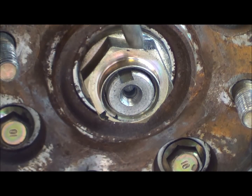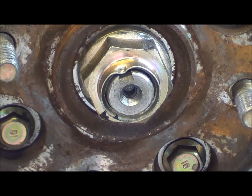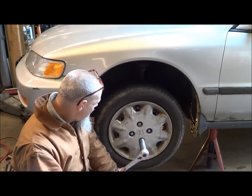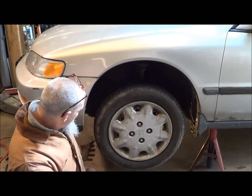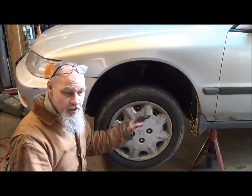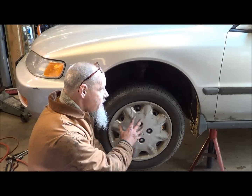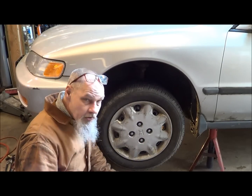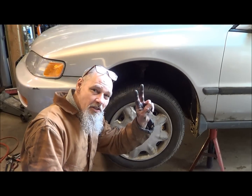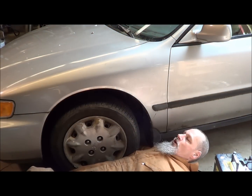I don't want to use a chisel to cut it — I just want to kind of put a dent down there to lock the nut. I'll snug them down with this and then put it on the ground and torque them down. I also have to remember to tighten the wishbone bolt underneath. That'll be it for this side. I still have to do the other side, which is a shorter axle but basically the same monkey business. One side done in a little less than an hour, including monkeying with the camera and having never done this before. Thanks for watching — and snug the old wishbone down.